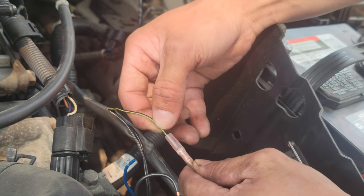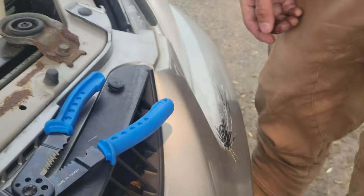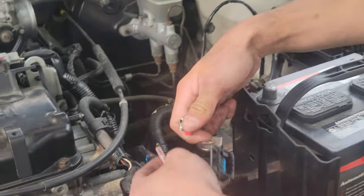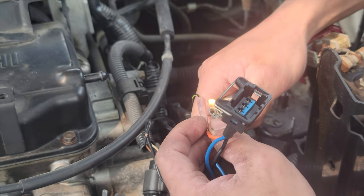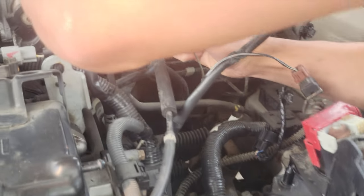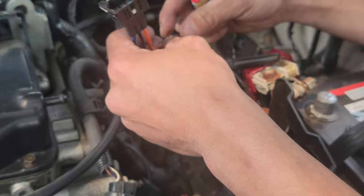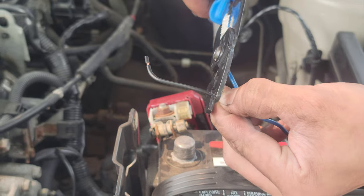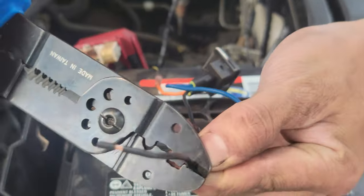Check if it falls out — that's pretty secure, I'm yanking on it. Now the last part for this wire: grab the lighter and shrink it. Make sure you're only shrinking the plastic part, not the wire itself. The wire is important — you don't want any damage to it. You want a perfectly snug fit around the wire so that it's protected. Let that cool down.